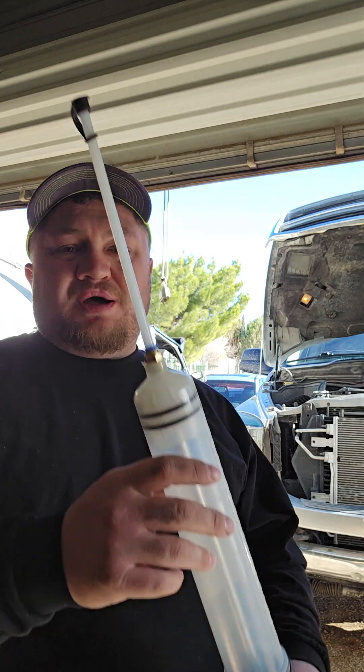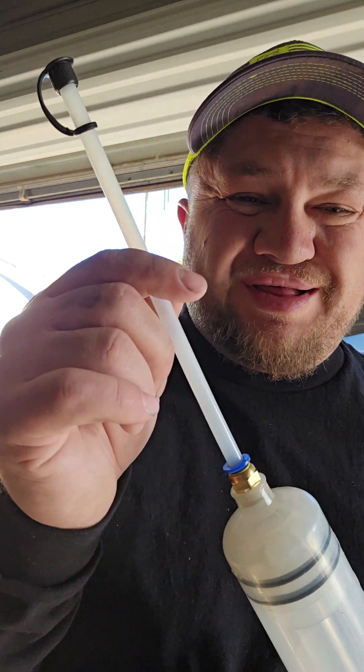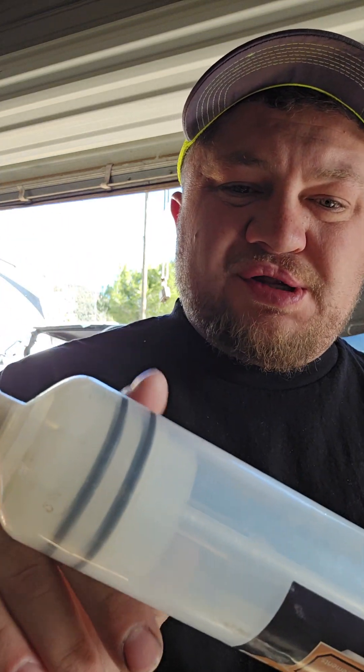This first one — one of these really big syringes. This thing works amazing. It comes with like two tubes, comes with new seals. If these ever go out, you're able to take this apart completely and clean it. I wanted to suck out all the power steering fluid when I did my power steering pump, and I didn't want it all leaking out when I took the pump out, so I was able to just pull it and it took it all out.